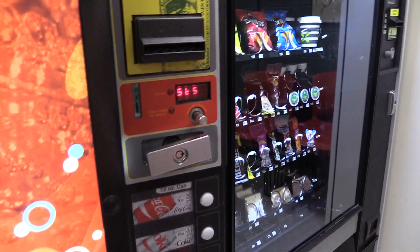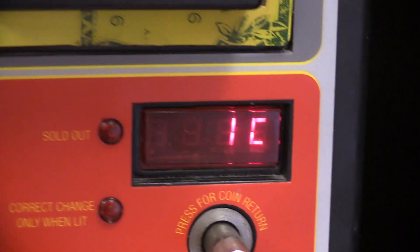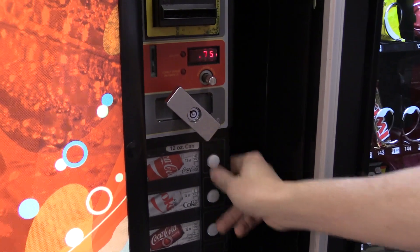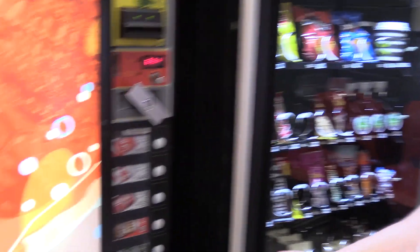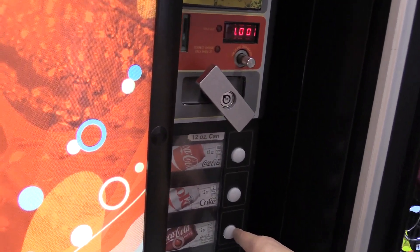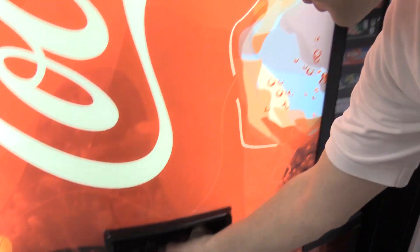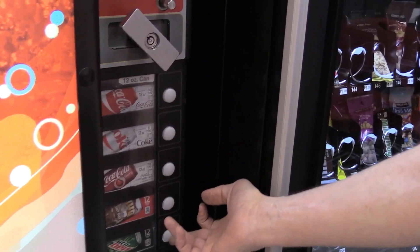We've set the Space to Sales. Once you save it you can close up the vendor and go back to sales mode. Let's test it — most of these drinks are 75 cents for the cans. Let's try Coke on button one; it vends from columns one and seven, alternating between the two. It vended the Coke correctly. Let's try Cherry Coke, which should come from columns three and nine — it's probably taking it from column three first.